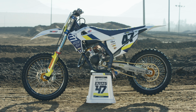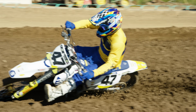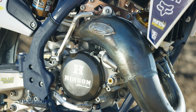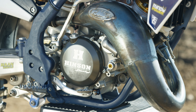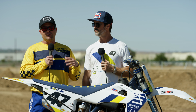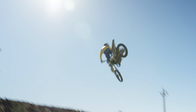That's money. I encourage people, if you have one of these bikes, good for you. If you want to add some easy horsepower, whether it's a Husqvarna, KTM, or GasGas, there is a kit that they sell: cylinder, head, piston, ring, black box. And you drop it right in. It's very simple, and it boosts your torque and horsepower numbers up to where you'd have to modify a 125 quite a bit to get that kind of performance out of it. And it's reliable. Like I said, just drop-in, bolt-on horsepower.